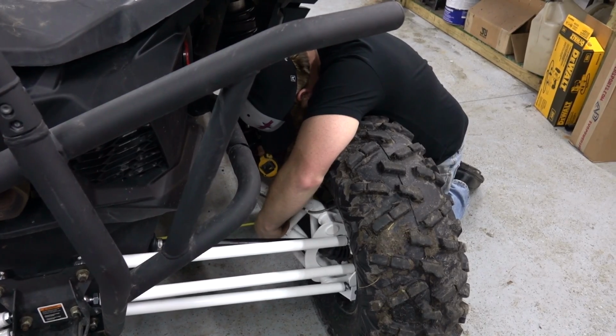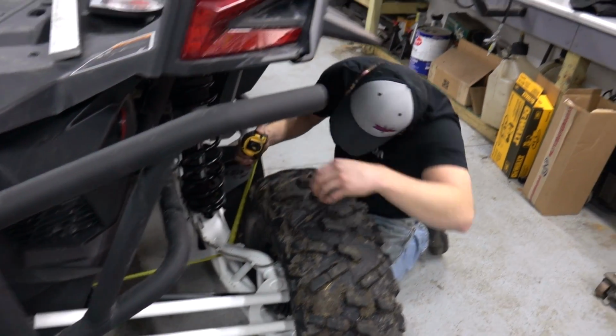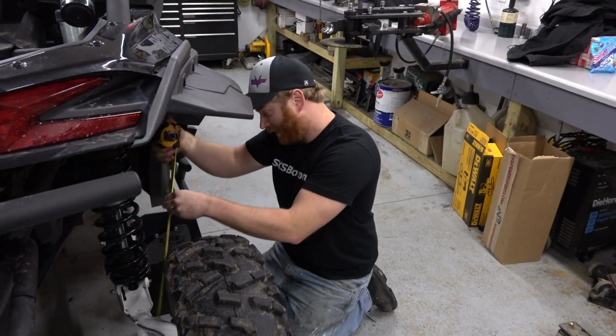Holy smokes. I got about 52 7/8. That's so almost perfect. Yeah, we got an 1/8 inch of toe in, which would run just fine. We'd be fine there. I'm almost willing to say we'll just leave it, dude.